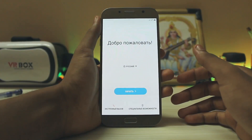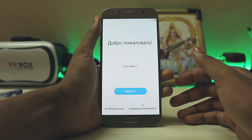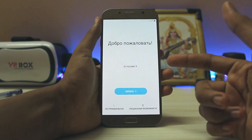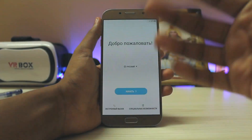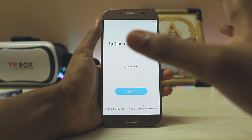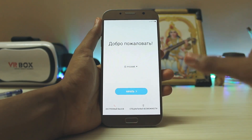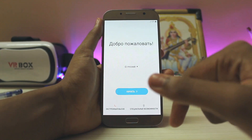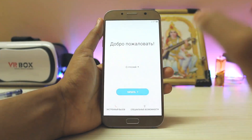It will start the Android Nougat flashing process. As soon as your computer shows PASS, the device will automatically reboot. Just 3 to 4 minutes after unplugging, the device has booted up. You've successfully installed Nougat! As you can see, the language is in Russian now. Since I'm running a Russian firmware on my Indian device, VoLTE won't work until the Indian firmware comes out.